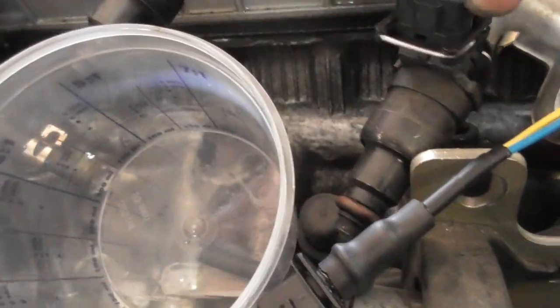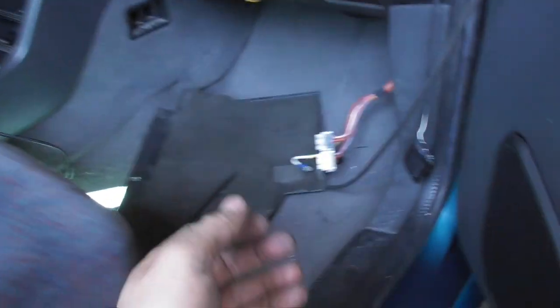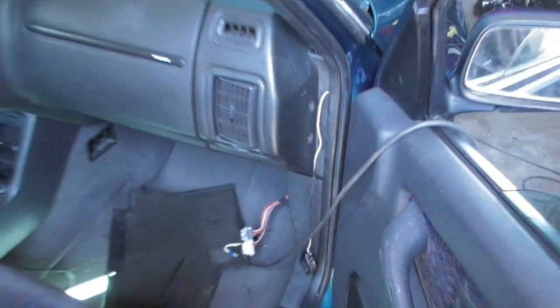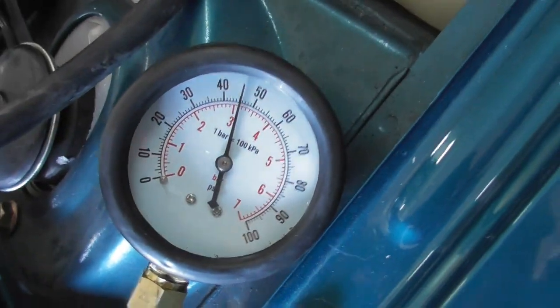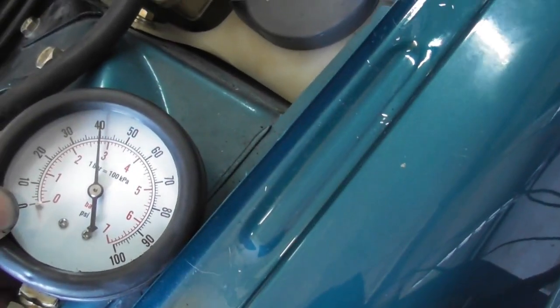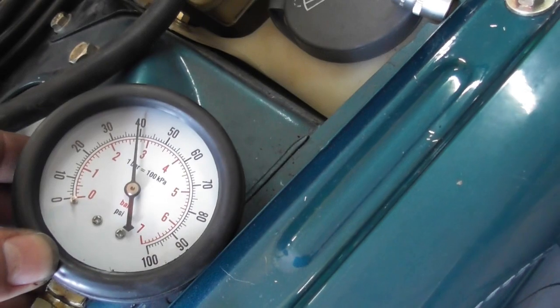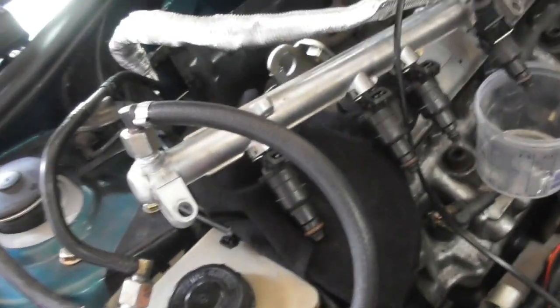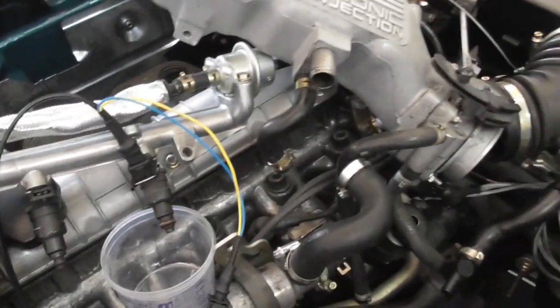Damn child proof connectors here. Prime the pump — we expect 3.1 bar. Perfect. Push the button for the last time. Now 2.7 bar. So that means all 4 injectors are equal — no problem with that. I can use those.